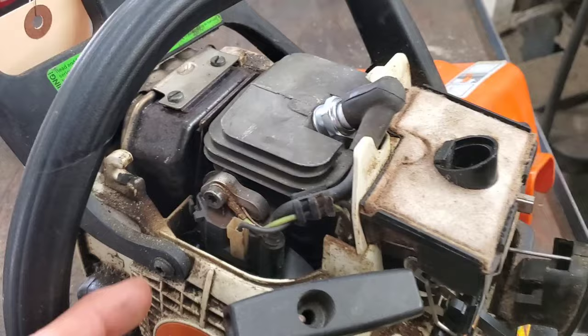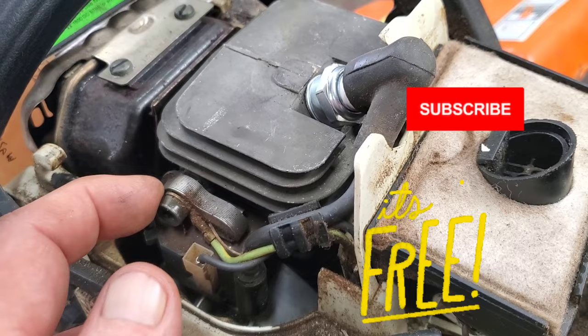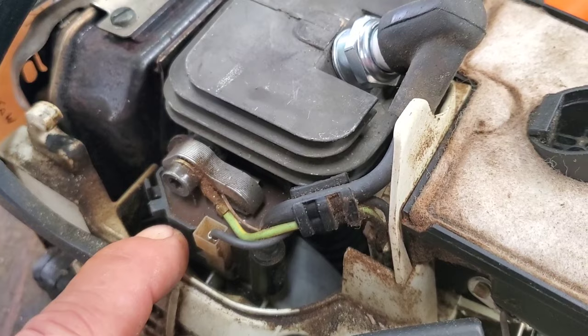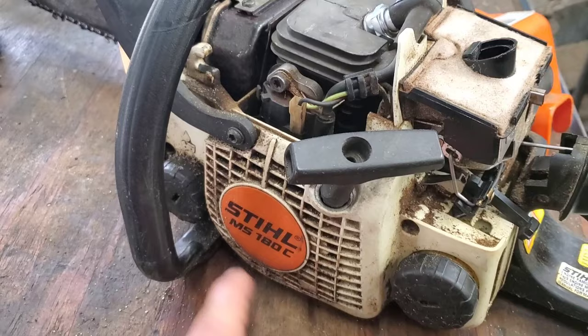One thing I didn't mention out there: this is a little chainsaw I'm going to show you on too. Where the screws go — like on that riding mower, push mower, or whatever — where the coil meets the engine, where you put your screw through, be sure that you clean off that stud where the screw goes into the engine with a little sandpaper. That's always a good thing to do. Then reset the gap between the coil and the magnet on the flywheel — I think it's 10 thousandths. Get a business card; works perfect every time.